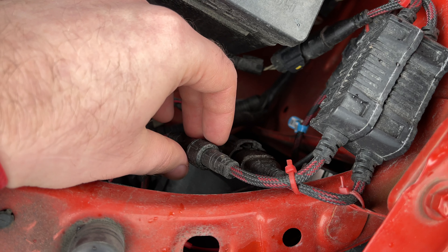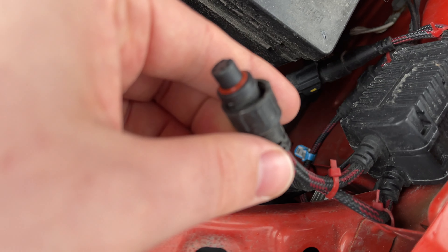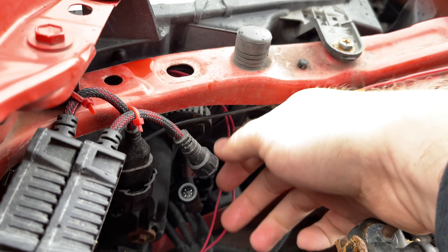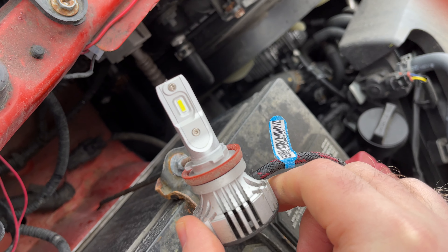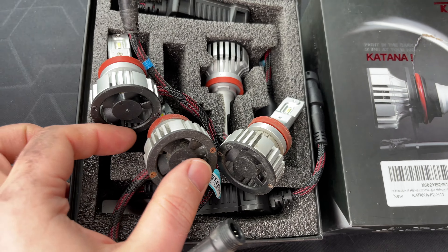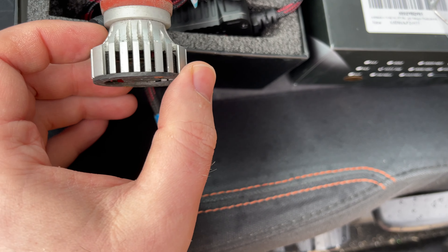To hold the LED light to the driver you've got this nice screw-on cap, and once you undo that there are your couple of wires. There's a nice rubber seal right there so you don't have to worry about any water getting in. All you need to do is just twist — pops right out just like that. As you can see after over two years there's definitely a little bit of salt corrosion compared to the new ones.